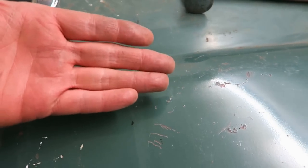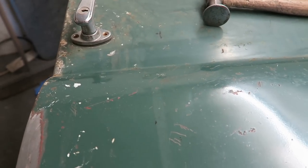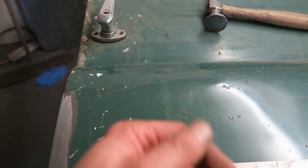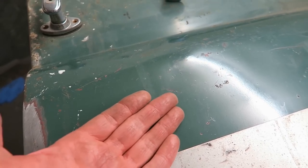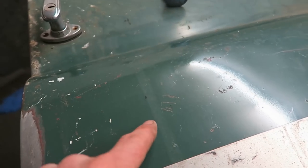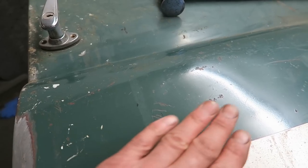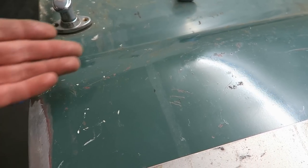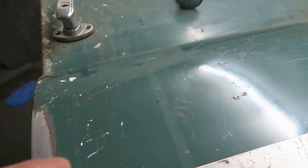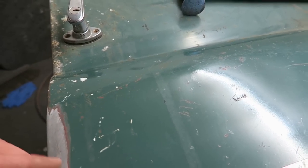So we tap the creases in, the creases straightened out. They pushed tension back into that panel and popped the dent out from this way. So the dent popped back up as the creases were hit back down. If we'd gone in and tried to lift first, we'd have just ended up putting lots of high spots in the panel in this area, and it still would have been dented. I can guarantee it till that crease was released. So by releasing that crease first, we've avoided all that unnecessary extra work and brought most of the damage out straight away.